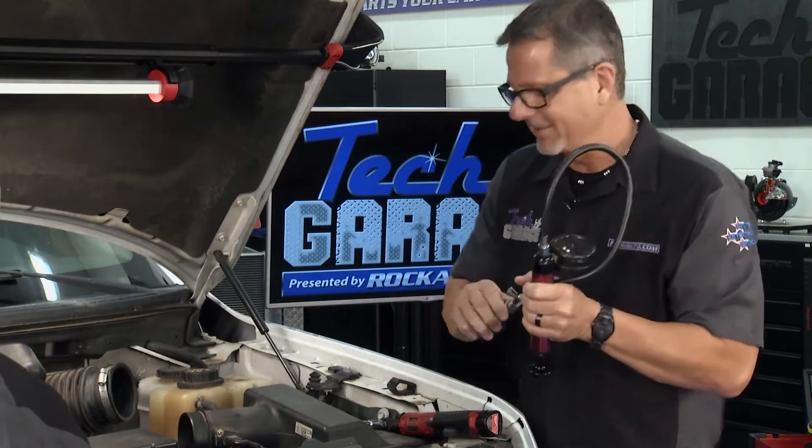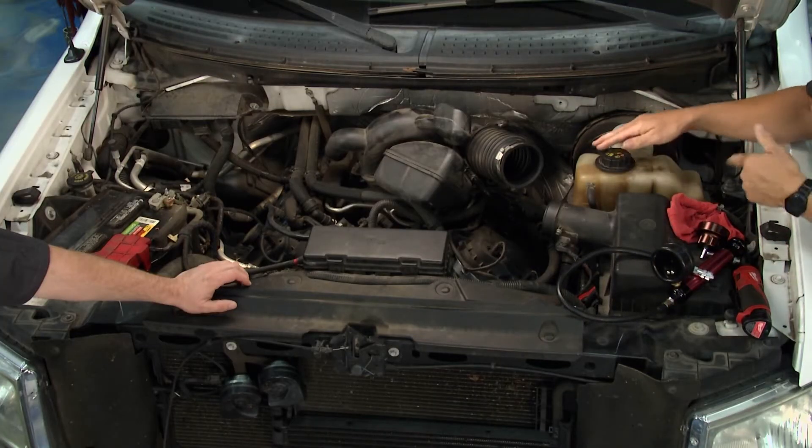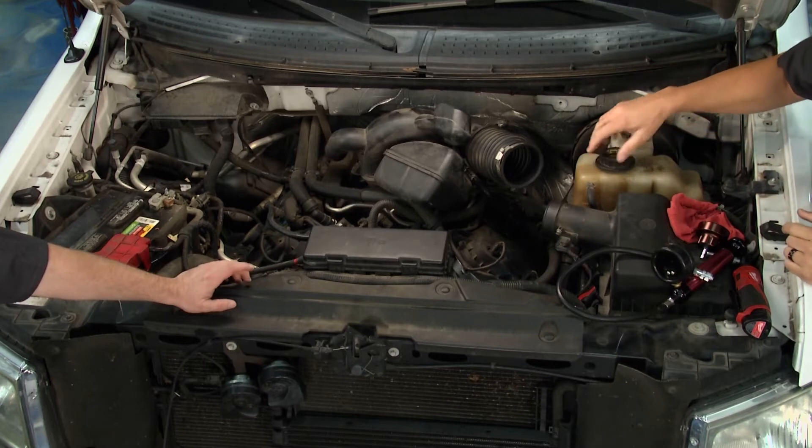You're always two steps ahead — good thinking. Yeah, it's wet down there. If you're going to use a pressure tester, just make sure the engine is cold. Ours has been sitting all night so we don't have any pressure in the system. Super important — nobody wants to get boiled.